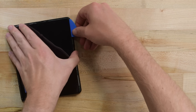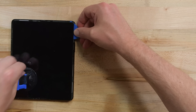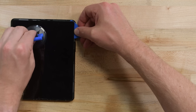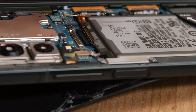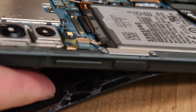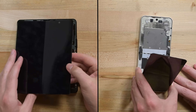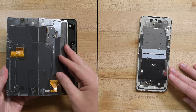Less dangerous doesn't mean easy in the case of the Z Fold though. The adhesive holding down that flexible glass is some of the most obnoxious I've ever encountered — it's sticky, and Samsung has applied it almost all the way to the center of the fold. Making matters worse, there's one cable that just barely doesn't have enough room to slide through the frame, so I had to loosen the motherboard to give it enough room to wiggle free. After that drama, I can remove both of the bendy displays.